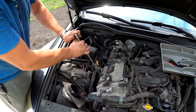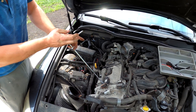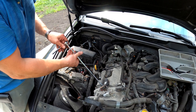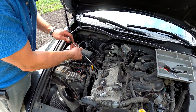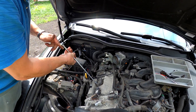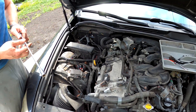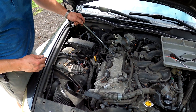You can see this has been replaced — did you replace that? And guess what, it's been replaced in the same cylinder because that cylinder has a misfire. Why does he have a misfire? Because the valve probably already had a little gap and there was a small leakage, so it was very sensitive to getting a misfire because probably compression wasn't that great. But what was that clicking sound? There was always a little ticking sound.